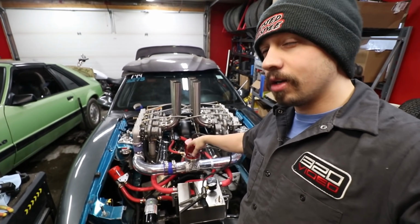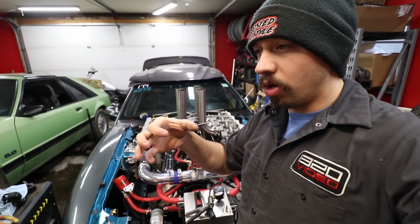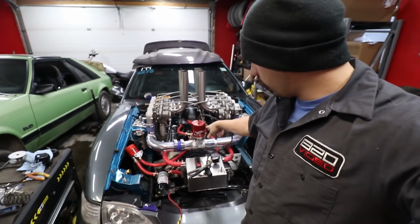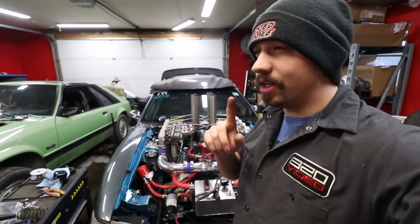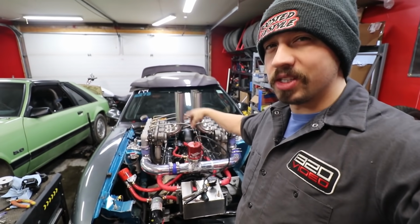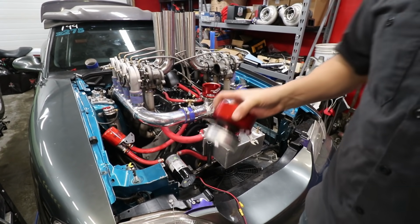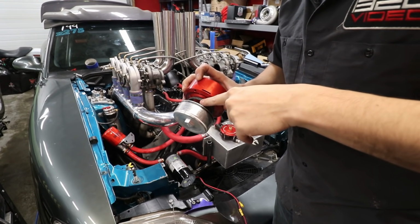The springs that I've been using in there are for a 44 millimeter gate, so the piston inside the gate is actually smaller, but the spring here I have is for a 60 millimeter gate with a bigger piston, so it'll be much more suited for something like this. So we're gonna pull that out, cut a piece off that one, put that one back in and redo our test, and it should be a little bit better because the piston in the 60 mil is much more comparable to the piston inside this. Instead of just sandwiching one giant spring in the bottom, we'll test that out first. This is like an 8 PSI spring on a 60 millimeter gate, so I'm hoping it works.